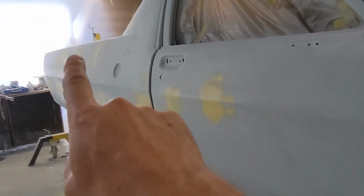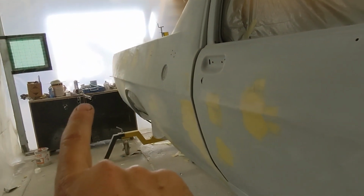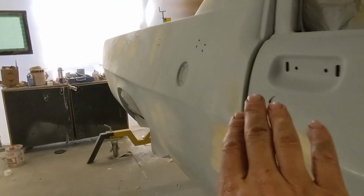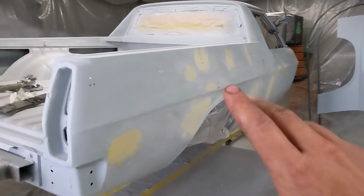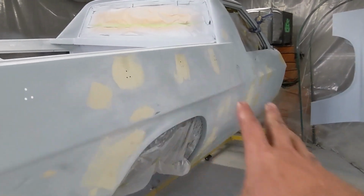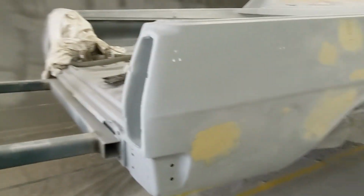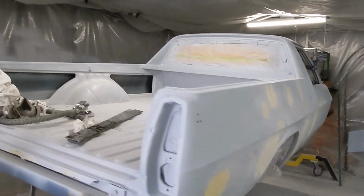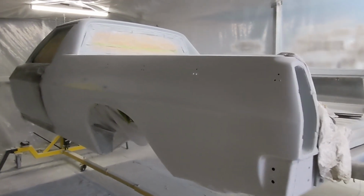It's a really good light coming through from this door, so I'll use that to my advantage. I'm just going through now, sanding it all back. So that'll be the next episode. Get that into polyester filler and high build, and then it'll be ready. I'll seam seal the underneath. I'm pretty sure that's all I need to do before I lower it down. So I'm very excited to get it finally back on the chassis. I know it's been ages, but you can't rush these things.